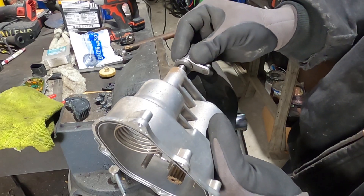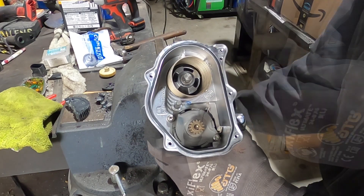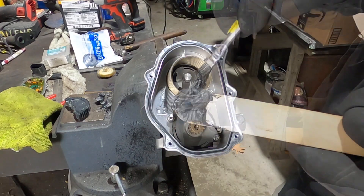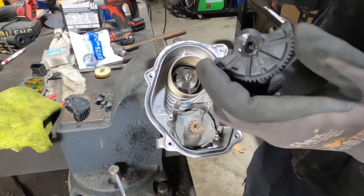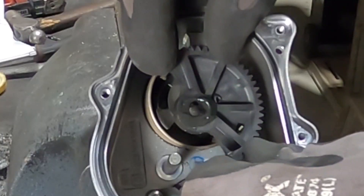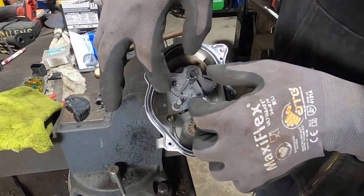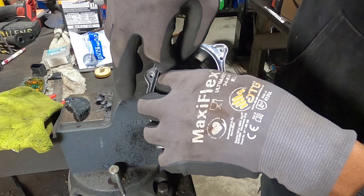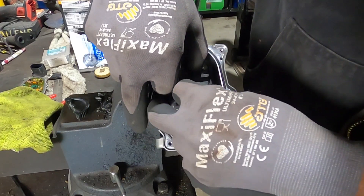This can now push in. The instructions say to use a little glue, so I'm using some epoxy on the shaft and also on the gear to ensure there is no movement while in operation. Installing the gear, you have to hook the edge of the spring into that little loop right there and then turn it 360 degrees to pretension the spring, then install it to the shaft.